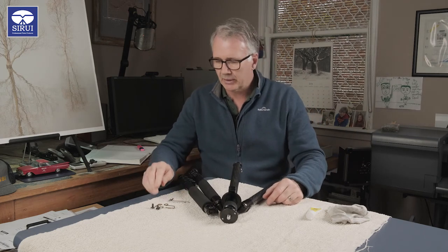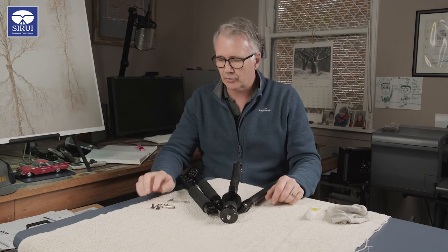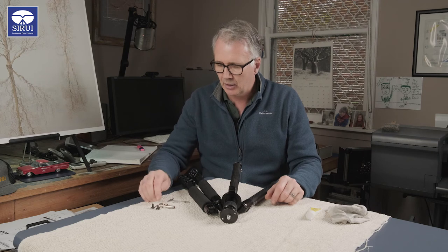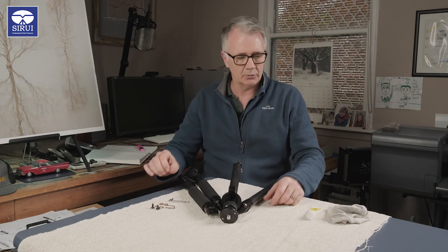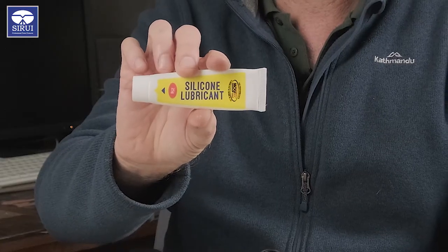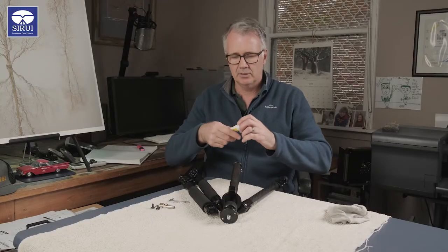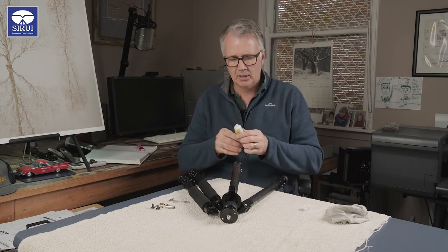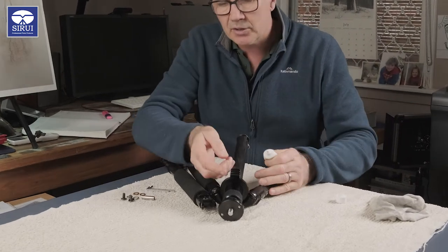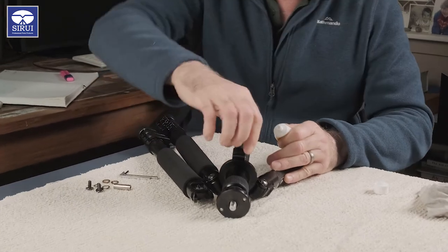So I've got all my bits. Just make sure you've got your two screws, your pin, and your four washers, and you've identified the washers with the flats and then the round washers. Now, the correct lubricant you want is silicone lubricant or silicone grease. If you're in Australia, I'll leave a link in the description below. I sell it on my website. So we just want a little smear on here and here.